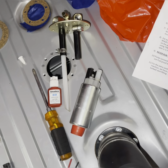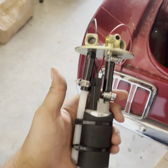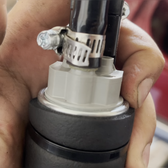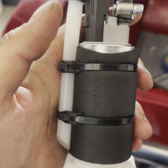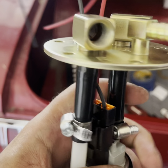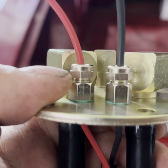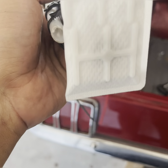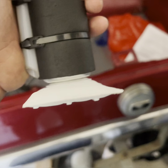I'm going to put the pump on now, assemble it, clamp it, put the cover on, and zip tie it. There you go — one installed fuel pump. The fuel pump goes inside this black tube, you have to work it in a little bit, then clamp it down. Before that, put this rubber or foam sleeve on to protect the pump. Use the supplied zip ties to connect the return line to the pump. Keep this plug in before you thread the pump in. Route your lines — it doesn't matter which side — then tighten these nuts on top to clamp down the wires and keep fuel from popping out. Really push on that sock and push it up snug — you don't want it falling off and junk clogging your fuel pump.